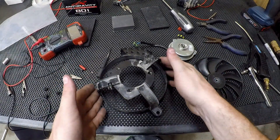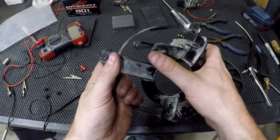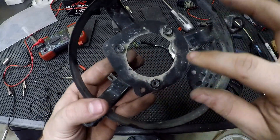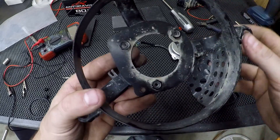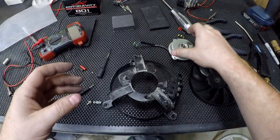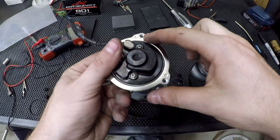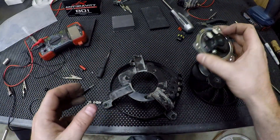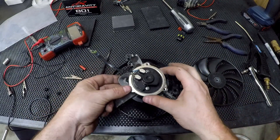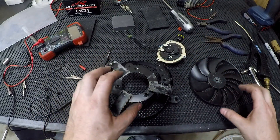I think I have a solution here. This is the stock KLR housing for the fan — I've removed the motor — and we have three mounting screws with nut certs, so it's a captured nut and you thread in from this side to fix the motor to the housing. The Ducati motor you actually screw through the housing and into the motor itself — they're kind of opposite. But they both have three mounting screws and they get really close on alignment; you can line up maybe two, but I need all three equal.